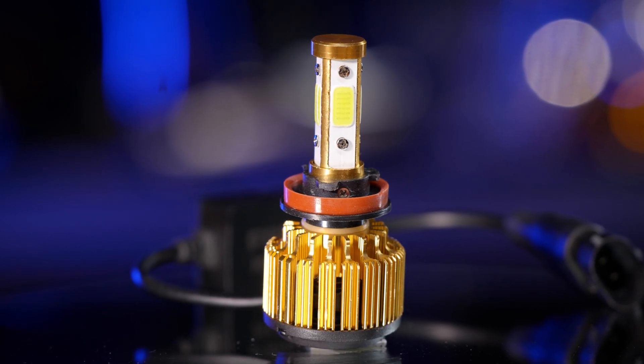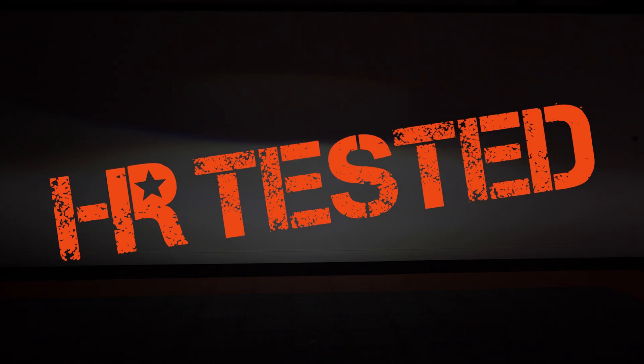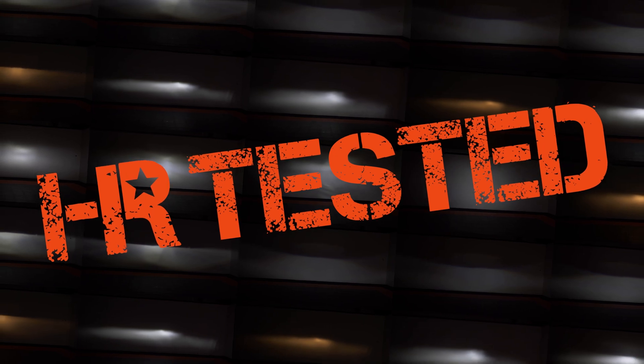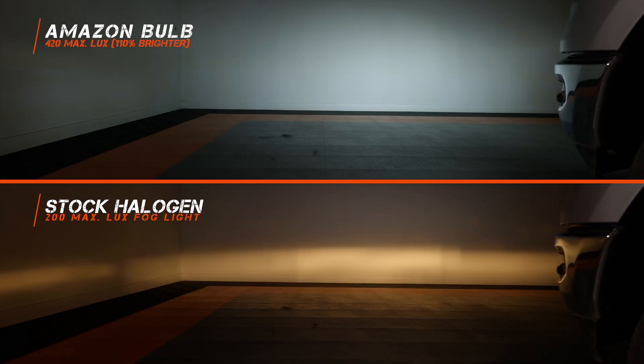For giggles I decided to throw in one of these multi-sided bulbs. Let me tell you right now — do not buy multi-sided LED bulbs. We've made whole videos on it. Tons of LEDs on a bulb does not mean it is brighter. That means you're going to get a flood of light that looks just like this — dim and completely useless, not drivable. When you're driving with something like this you're going to continually get flashed by oncoming drivers because you are blinding them. Steer clear from this cheap Amazon garbage — they all seem to be the same manufacturer and all they do is change the color up now and again.